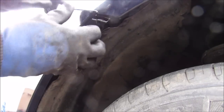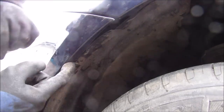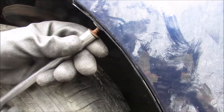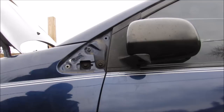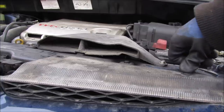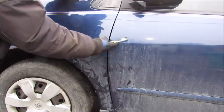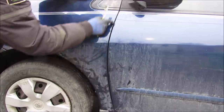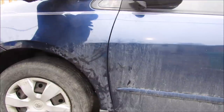Next I'm going to put the splash guard around the bumper, push the bumper in, and tuck the splash guard in and around so the holes line up. I'll insert the clip into the bumper and rotate it 90 degrees so that it's locked, then replace the fender screws and pop the cover back on. Next I'll replace the top clips above the radiator support. Now with the fender replaced and the new hinges you can see that the body line between the door and fender is nice and consistent all the way down — it's not drooping anymore with a big gap at the top.